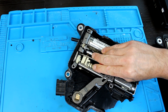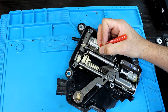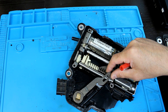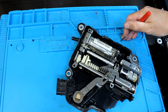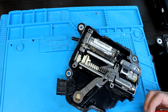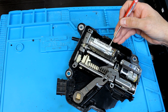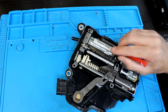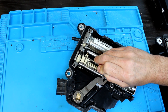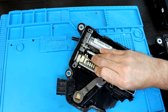What typically happens when this occurs is the car gets stuck and cannot be shifted out of park unless the whole assembly is removed and you manually move the gear selector into a neutral position. This can be a pain if you're trying to get the car towed, especially if it's in underground parking. It's not an easy thing to deal with to get it to a shop, and once at the shop it makes it hard for us to get it in the bay. Mercedes, because they saw so many of these fail within warranty, decided it was a bad design and needed to be upgraded to something more robust.